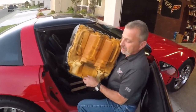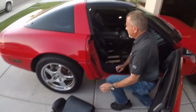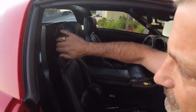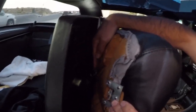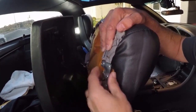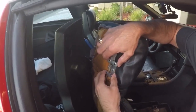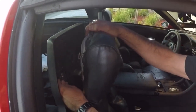There's the little lever I was talking about — that's all there is to that. On the backside of the seat, normally there's two latches. This one actually had one torn, and I wasn't going to fix it until I redid the seats. They have a little metal clip here in the back — you can see that right there. This one had already come loose, but there's normally one right here glued also. These little guys just hook on — you can see it's still hooked on. When we get to this, I'll just glue this back in with some silicone. The wire snaps onto here like so — that is normally mounted right here and holds the back of the seat in. You have the same thing down here in the back too.